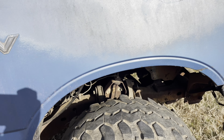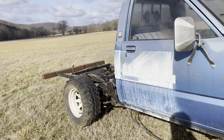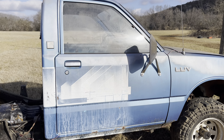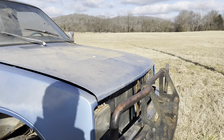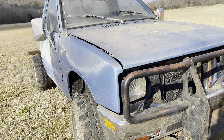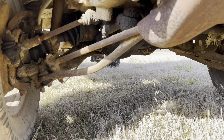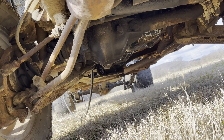This is the first out of three that we're bringing in. We've already got one — it's a '78 four-wheel drive that I did quite a bit of work to. I put a 2.6 out of an Isuzu Rodeo in it and converted it to a Weber carburetor. Then we have this '81, and then we have an '80 model old body style coming — that's a basket case flatbed we'll be doing quite a bit of work to. And we have a '76 or '77 parts truck that comes with it. We'll be piecing together a couple of good farm trucks.